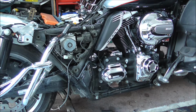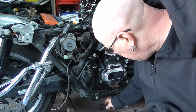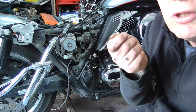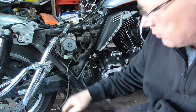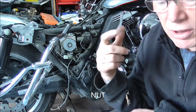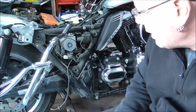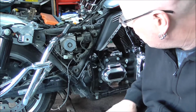Yeah, and on the front cylinder head, basically I went in with a long reach, 1/2 inch, and just slid it up on the inside. Like if that's your leg shield, I was up on the inside of the leg shield with the little ratchet, and then for the other bolt, I came in from the other side of the bike because it was easier to get at. So it's not hard, it's just fiddly. And while this thing's in bits, I'll give you a wipe off.